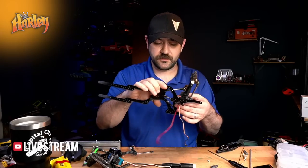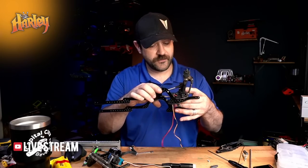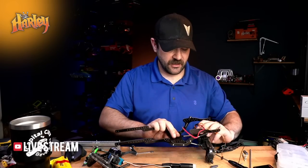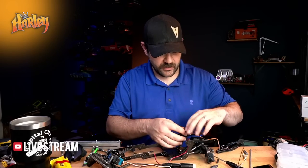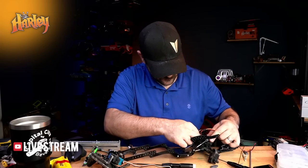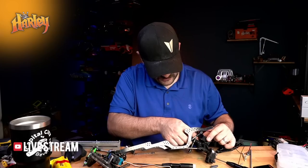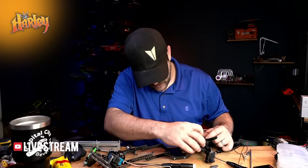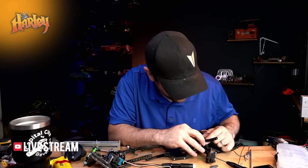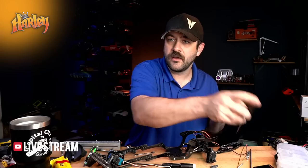Crazy short links, but we are clearing his skid plate. Those link angles still work. That Brazen scale's got enough angle in the skid to allow it. Lucky us. I've got standard rod ends in here rather than the wider Currie pivot balls, but it's okay.